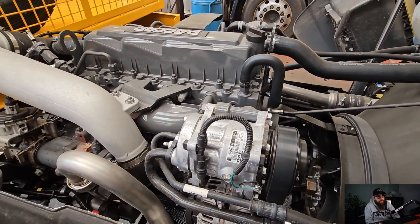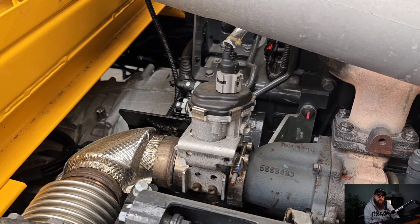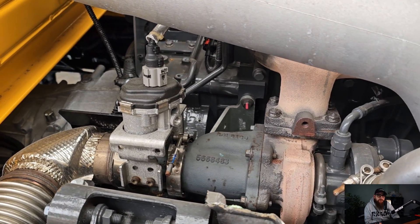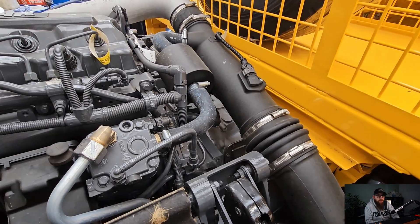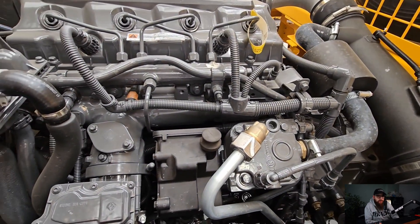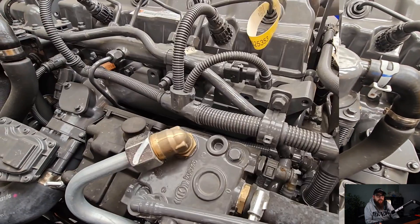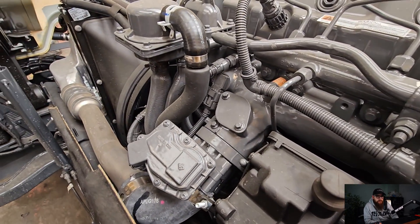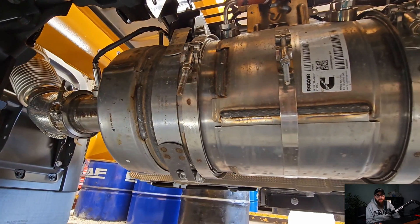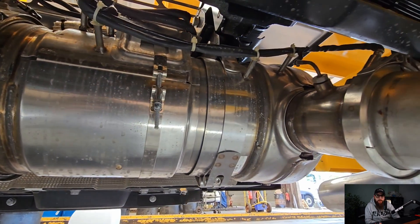I hope you've enjoyed this video. This of course is now a thing of the past - DAF have removed EGR from the engine as of this year and introduced throttle valve assemblies on the inlet and exhaust. I was lucky enough to catch up with this one at a body manufacturer I was doing some work at. As you can see, we have reverted back to a waste-gated turbo, so goodbye VTG. NOx levels are now fully managed by SCR with the new after-treatment system and updated AdBlue injector. Let me know what you think in the comments, and I'll catch you in the next one.